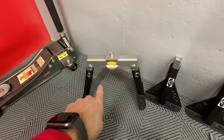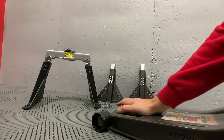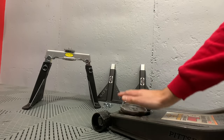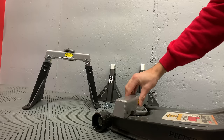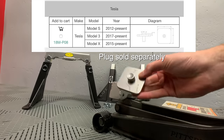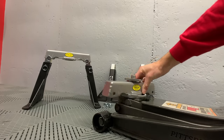What's really cool about these is the way they go together. You store them separately like this, they go together like this, and they are fully adjustable in height. I'm doing this outside of the car so it's easy to see everything. I have a jack I bought from Harbor Freight — a low profile jack, which is kind of what you need for a Tesla because these cars are pretty low since the battery pack is so low on the car. You take this main piece, put it on the plate, and it comes with a washer and the Tesla plug. You set this down, put the washer and the plug, and this is what's going to lock into the bottom of the car. You can move it in different directions.